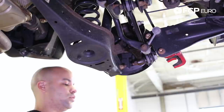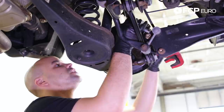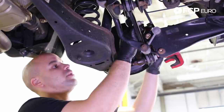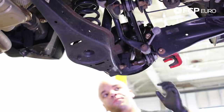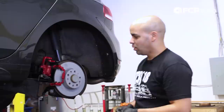At the rear of the spindle, I'm going to hold my caliper bracket into position, line up the bolts, and begin threading. I start with the top because it's the most visible — I want to make sure that as I'm threading into the spindle, I'm also threading into the caliper bracket. Looks like I caught the top one. The bottom one is harder to see, but looks like I caught the bottom one as well. Now these bolts are very long so it will take you some time to bring them home, but just be patient because you do not want to cross thread them.